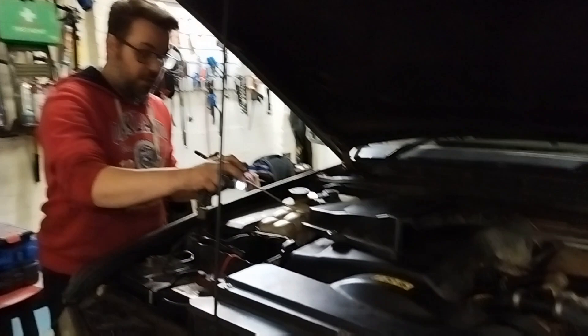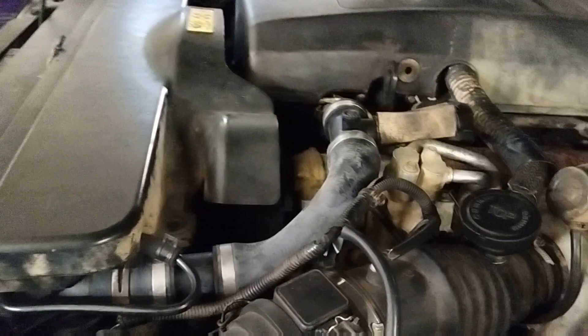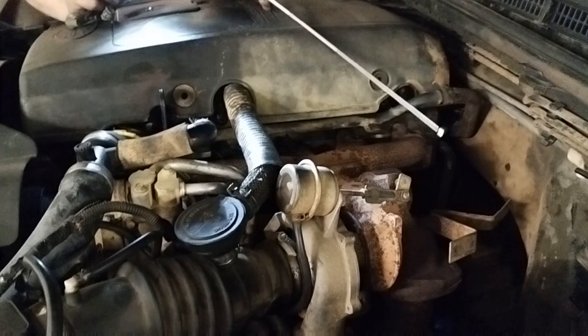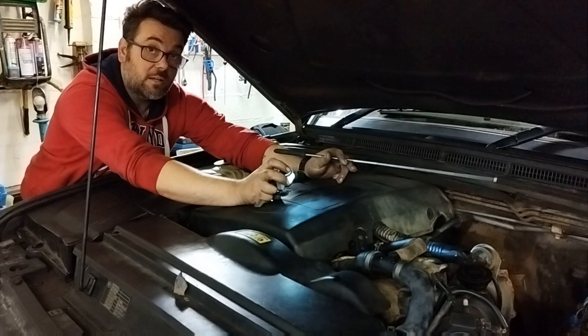Check all your belts and have a look at how they look. It's a chain-driven engine — this is one of the last real engines Land Rover made. So you don't need to check a cam belt, but check it's not rattling. When it starts up, make sure there's no smoke coming out the back. The turbo actuator tends to stick — if on a test drive you've got no power over 3,000 revs, it's probably a sticking actuator. Check on your dashboard that you've got no warning lights, no Three or Four Amigos light — that could be a hub or ABS sensors, around £80 each plus fitting.